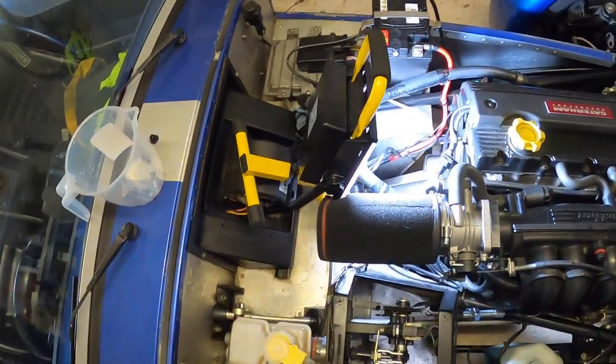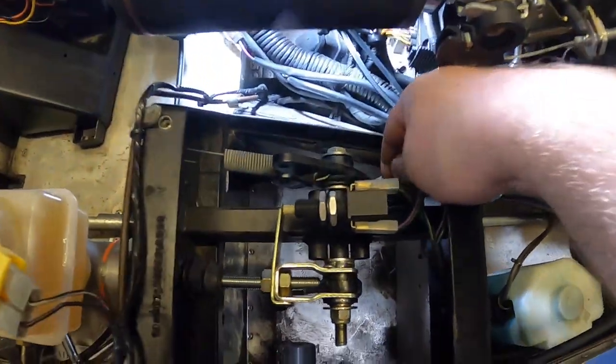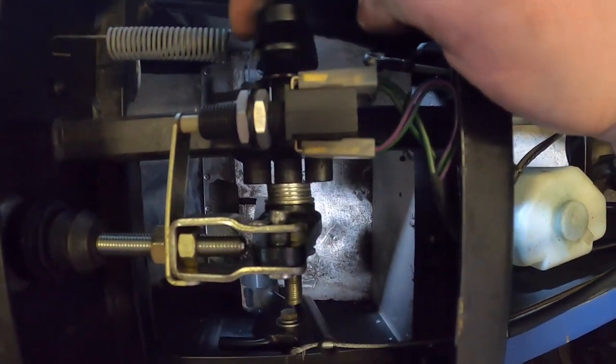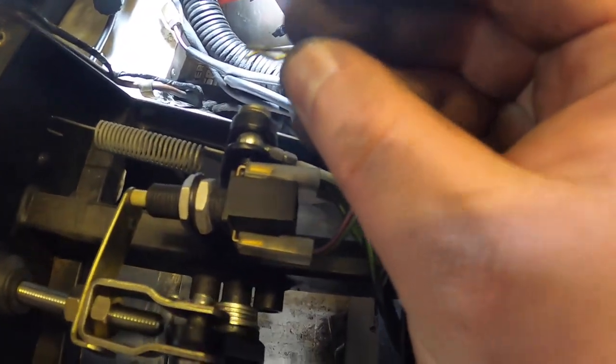Back on the other side of the car — the driver's side. I think I've got the pin located at the clutch end. We have to focus on getting the cable located within the pedal housing. After a bit of fighting, I seem to have the cable attached with the pin going through. I believe this R-clip is also known as a clevis clip, but someone in the comments will probably call me an idiot and tell me that's not true. Here's the final piece to go in.